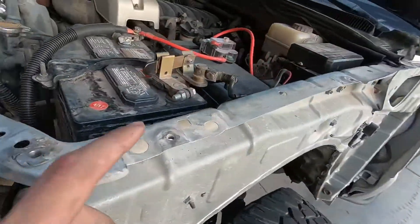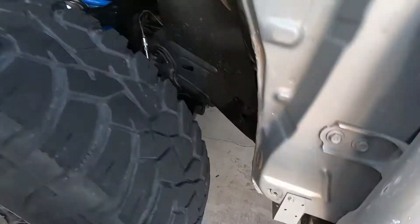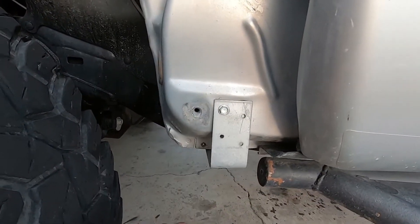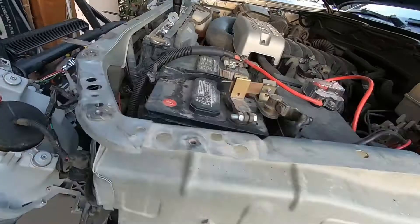Over on the fender side, you can utilize the same two stock fender mounting points. The only thing you're going to have to add is a bracket like this — I self-tapped it in there; I'll probably regret that, but it works for now. This actually holds the bottom clip of the fender flare. It's a super easy setup. To be completely honest, really anybody with maybe a little bit of experience with body paneling can knock this out of the park, no problem. I didn't have any experience when doing it, so take it for what it's worth — it turned out pretty good. There are a few spots I'm not super stoked about, but it's something I'm going to keep working on until I get it perfect.